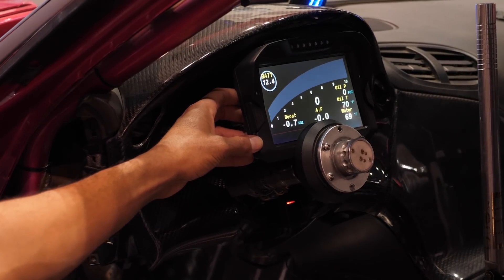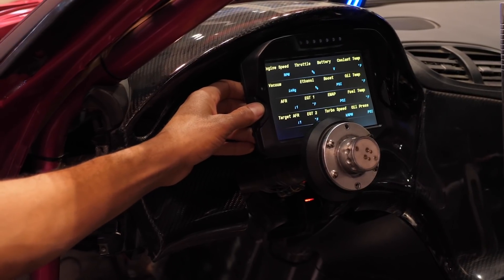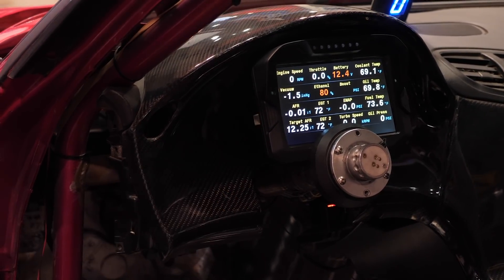Apex seal failures are one of the key failure points with rotary engines, and there's a huge amount of debate, argument, misunderstanding, and misinformation about factory Mazda seals versus aftermarket seals. The factory Mazda seals are actually pretty good, but in this case we're not doing what Mazda intended — drifting involves start-stop use with no cool-down laps. So pre-mix is used to help with the wear characteristics of the apex seal, which is ultimately the failure point. With a good motor, it's not just going to blow up — your apex seals won't fail suddenly, they'll just slowly lose compression.